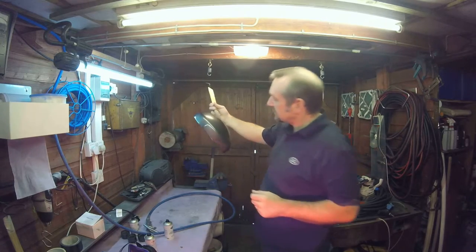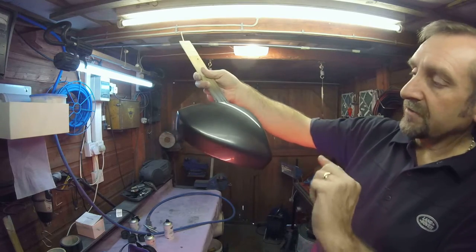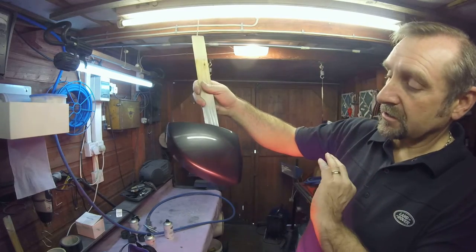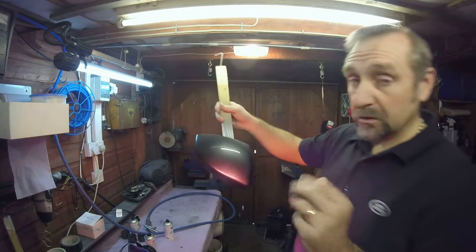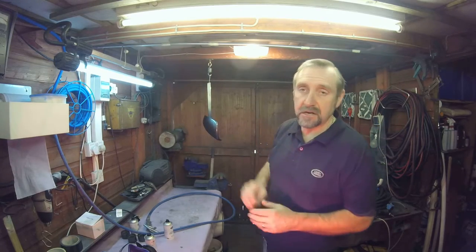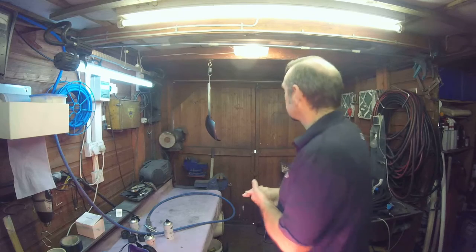This one's now starting to dull off very slightly. As you can see, again, we have no bits, no contamination, we have no silicons, no foreign bodies. It's a perfectly virgin coat of paint. I'm hoping that we do get a few little bits in it actually, and then I can take you through a fourth video, and we'll show you how to just denib a few bits and pieces and polish the surface. But there's not many painters that say they want to get dirt in the paint, but let's see what we can do.